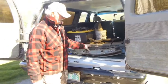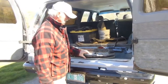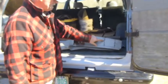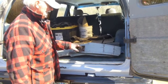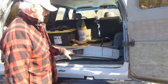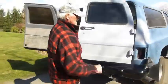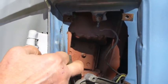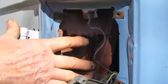Underneath this you will find this part here, and it will not have any nut plates. To get those nut plates off, you have to go from the back here, cut this out, and there are some spot welds that hold the bracket that holds the nut plate in. Once you take that off, you've got to take this bracket — the bottom ones will be right here behind your tail light. So you'll have to cut a square hole in here, slide the bracket in, bolt it in, and then weld it across here. Then this one will be set.